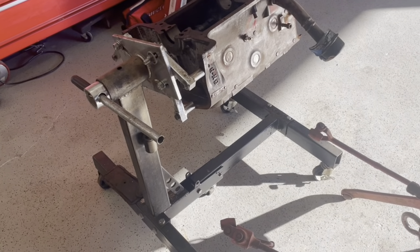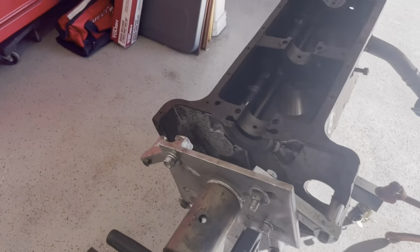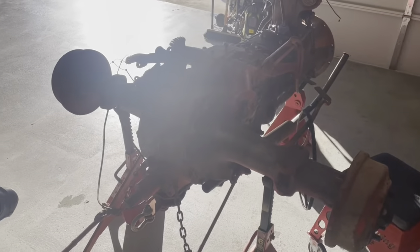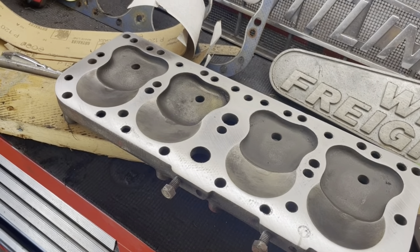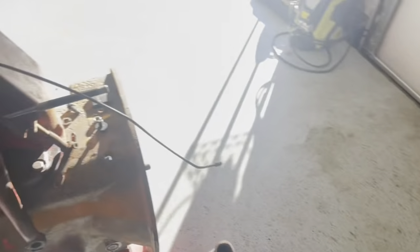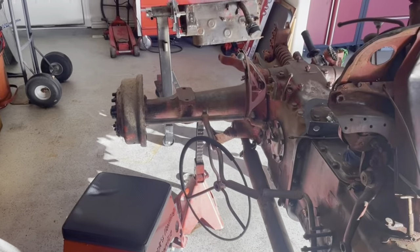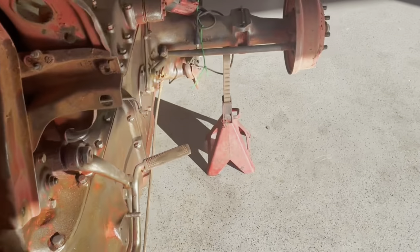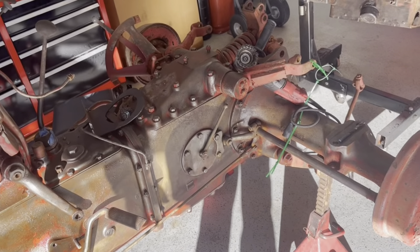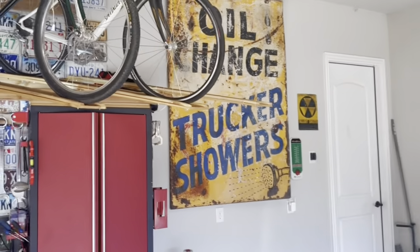I'm calling that good. I was wanting to get this one area a little more, but I can't feel anything there. This is a little bit away from where that head gasket was on wrong, and this is staining — that's deeper than I need to go. But yeah, the deck's flat. Looks good — pretty sure it's going to seal up pretty good. Next thing I'm going to do is take the valve train out of the block and do the deck of the block as well. Then I'll get bearings ordered, new sleeves and pistons, and get it all put back together. Hopefully I have a running tractor in the next couple of weeks. Let me know what you guys think of this project and if you like seeing this type of content. I know I'm mostly a cab over truck channel, but I do like anything old iron — this is another hobby of mine. Don't forget to hit the like and subscribe button — I'll catch you guys on the next one. Have a good day.